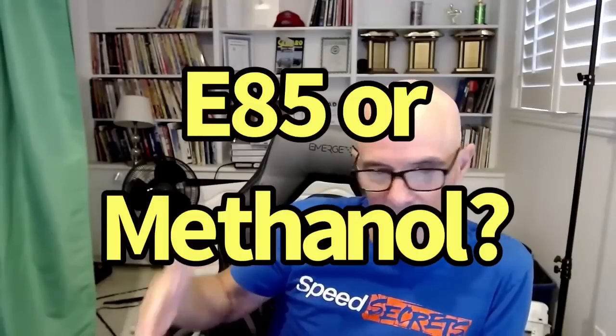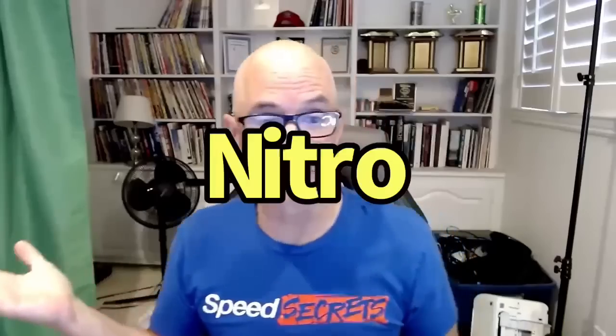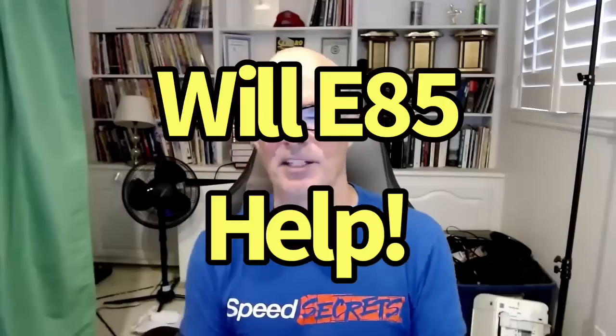We could also do this with fuel — we could try E85 or methanol, or if you really want to make the power, put nitromethane in it. I didn't want to go to that extreme, but E85 is always a given because I can just go get it at the local gas station right around the corner from West Tech. With a stock bottom end and just milling the head a little bit, we're probably only going to be around 10-to-1 compression, and I don't know that's high enough to really take advantage of E85 at the power peak — maybe methanol. I'd like to try it and see, it's easy to swap out, and it's a simple test.